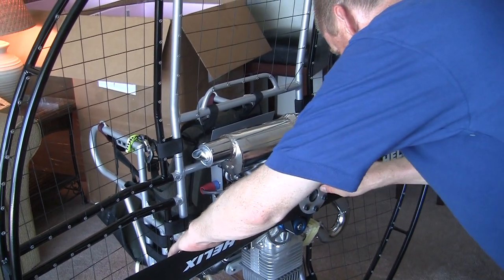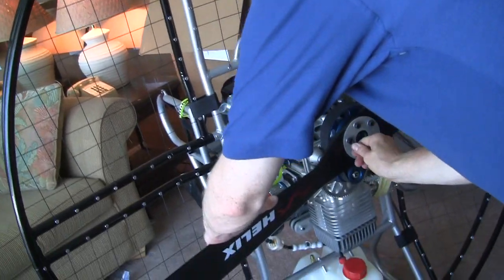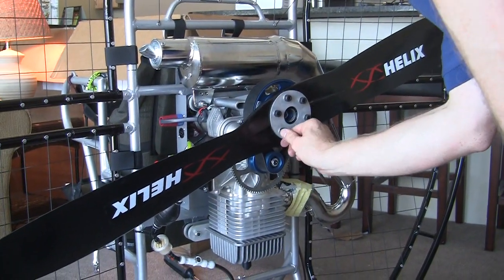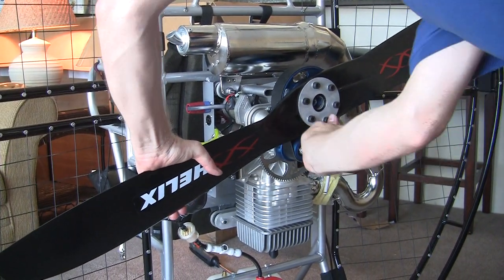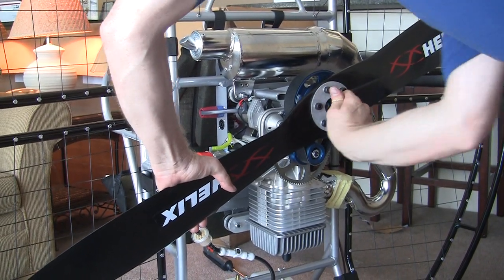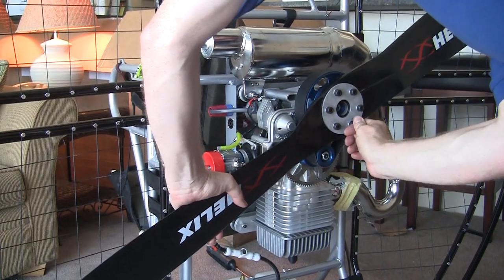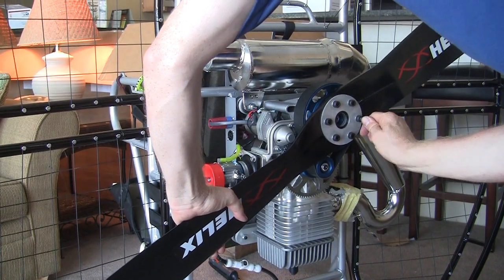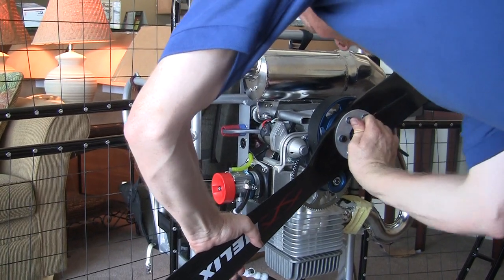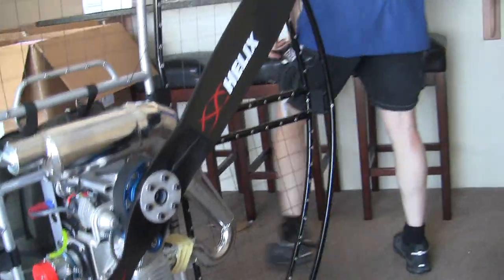And now all of these are hand tightened, and do them back and forth, crossing around so that they're all tightened evenly. And then once you get them tight, then you can just go straight around. And you're just looking for a good, firm, snug hand tightening. Beautiful, that's done. And the last thing we do is our air filter.